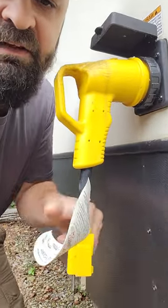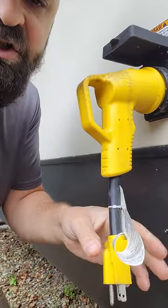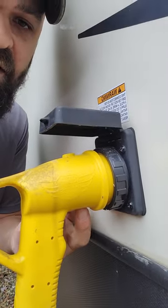I've got a 50 amp service on my RV, you might have a 30 amp. They're still big, and if you don't need all that much power you can go ahead and use one of these adapters like this. I've got a 15 amp connection on the bottom for a standard extension cord, although I'd probably use a weatherproof, waterproof type of extension cord, and your 50 amp connection on the RV side.